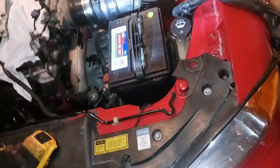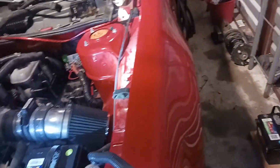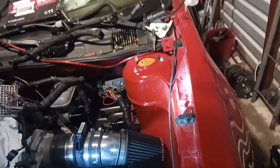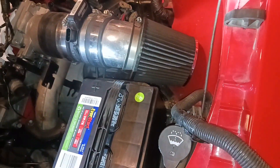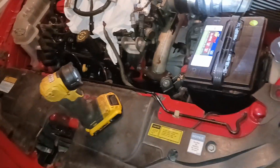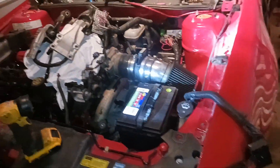So I'm going to keep working on this thing. I'm going to try to get in there and get that clutch pedal bolted in so I can get that push rod in and get my clutch master bolted back up to the firewall. Then I'll be able to get the fuse box installed and get everything hooked up and clicked into place. After that I should be able to hook up the battery and at least try to crank it over and see what happens. I know it's not going to start — it's not going to have fuel, there's no injectors. But yeah, I'm happy, so I'm going to keep working on it and I'll give you guys another update.